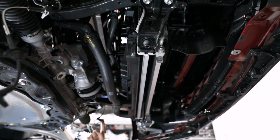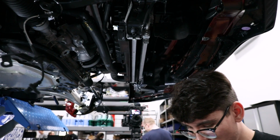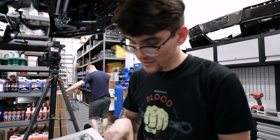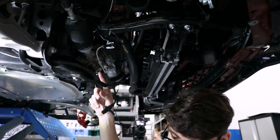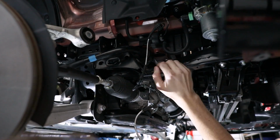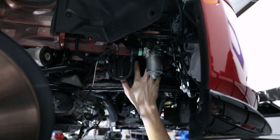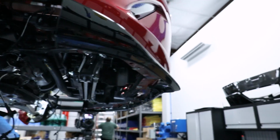So on the side, got down here, Bryce? It says I need to remove two 10mm bolts holding small plastic pieces above the sway bar, then pull the plastic pieces out. There's one on each side, driver's side is shown, so it looks like it runs this way. Oh, okay, so these right here. These plastic pieces. Got it. There's two, one, two.